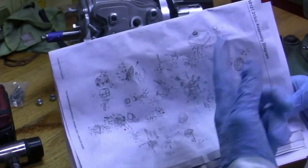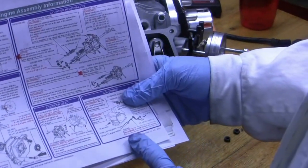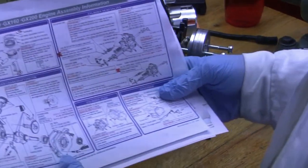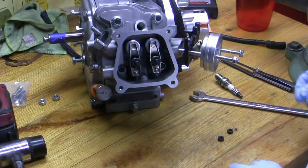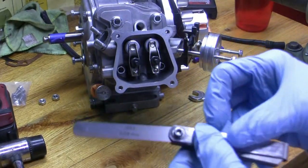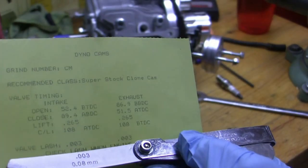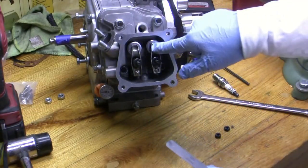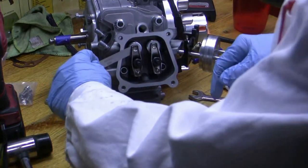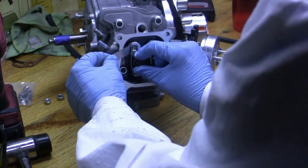You can see this thing is going to really screw you up. If you don't get this sheet right here, which is the Honda Motor Company 2009, you're just not going to be able to read it. What I do when I set the lash cap is I set them — it says right here it'll give you a piece of paper, same thing. Right there it says 003, 003, 003. When the one's down, that's the one you check. Just keep doing it — don't just do it once, do it about 10 times. And when the other one's all the way down, you can check this one.